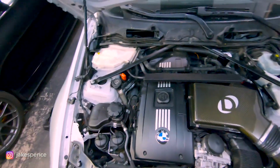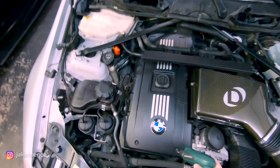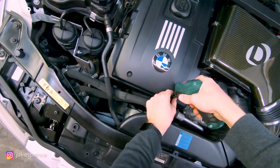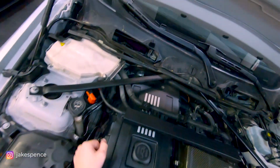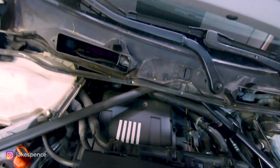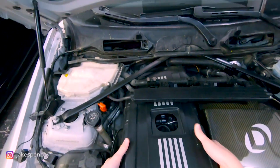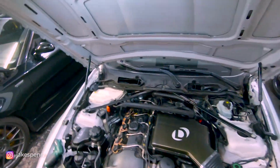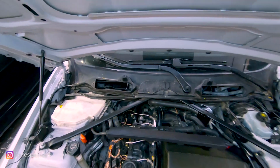And now, take our little bit driver, and I believe you wanna get a 5 mil bit here, and that just goes into this engine cover, and we'll remove these bolts. Looks like I'm already missing the one in the back, but there is another one in the back there to go ahead and then pull this up and remove this piece. So pretty quick. But again, that's a 5 minute thing that you could avoid with those cowl filters up there. So I'm definitely gonna do that mod in the future.